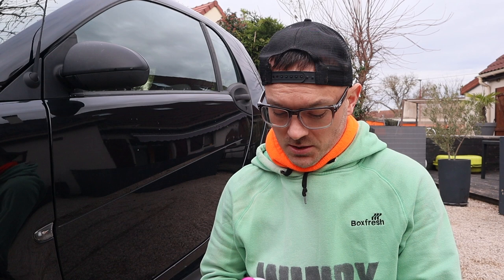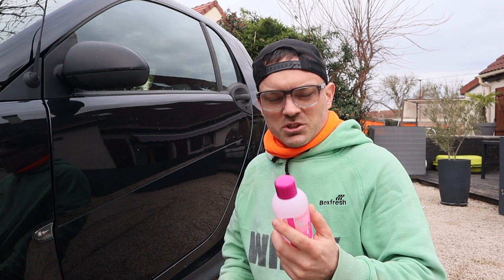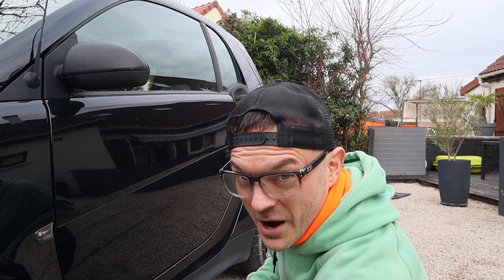I've been and raided Adit's makeup cabinet and got the nail varnish remover. I really do recommend it — if you're removing any masking tape after some painting or anything, rob your missus' nail varnish remover. But don't use too much, because then you don't even have to tell her. I'm actually going to use this whole bottle, so I'm probably going to get in trouble. Now it's the case of attacking all that remaining glue on the plastic paint. Just be aware that solvents can tarnish the shine off plastic, or can just melt it straight out, so you have been warned. Guzzle it onto a little rag, and off we go.